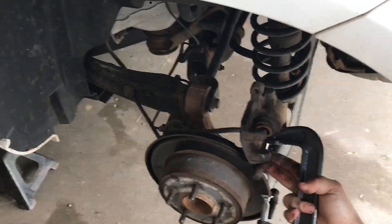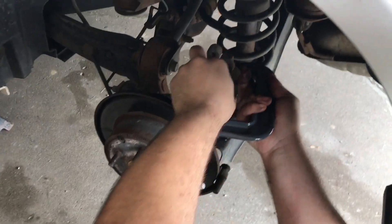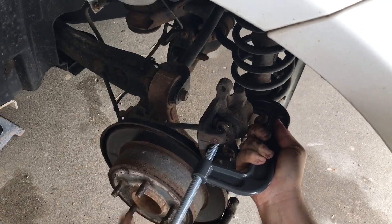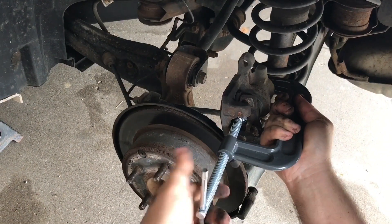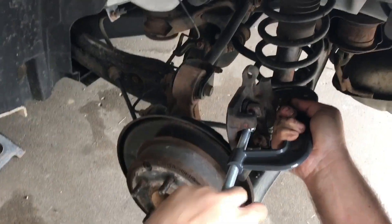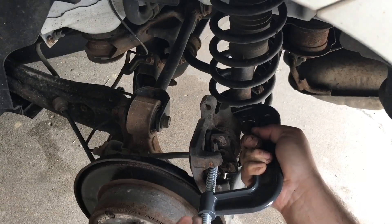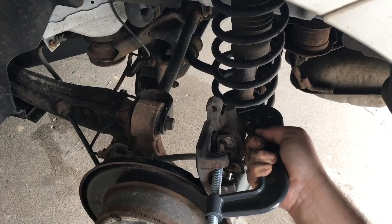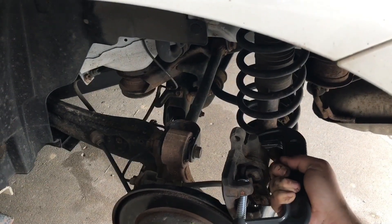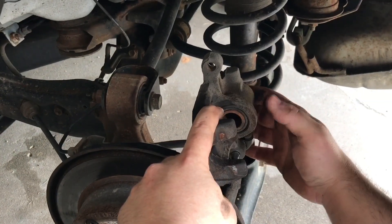What I'm doing now is one of the oldest tricks in the book. I'm taking this old brake pad and putting it up to the brake cylinder here. You have to push it back — you have to reset it to get it flush. And I'm using a tool called a C-clamp. You can see how it's pushing that back, it's resetting it. And that way, the new brake pads will be able to be put on. Now, if you can see, this right here is flush.